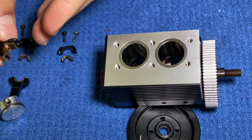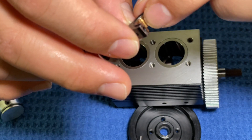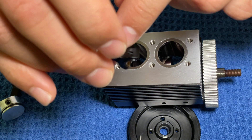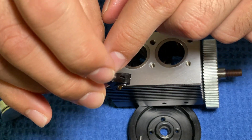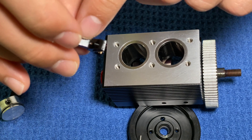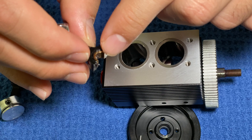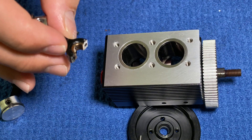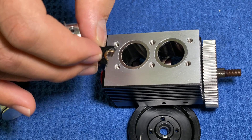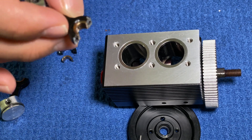I've already put in half of the main bearings and something interesting I've noticed is that there is a little hole in the main bearing and there's also a little hole in the same place on the connecting rod. What this does is take the oil that's in the crankcase and that oil goes in through the connecting rod into the main bearing, lubricating the journals on the crankshaft. I think this is a spectacular attention to detail and an awesome feature to keep the journals lubricated.